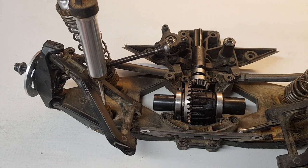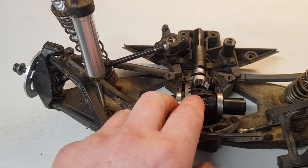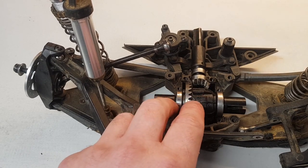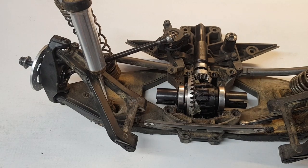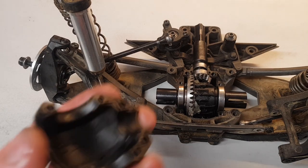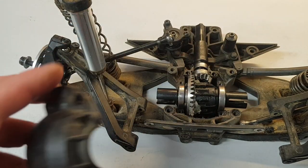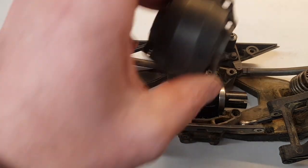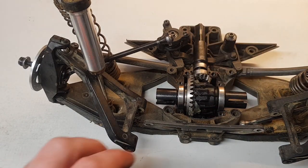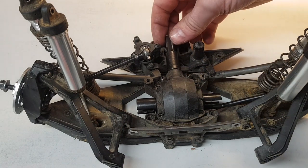Now you need to decide how much grease to put in. You don't need to pack it full — when it spins around it all flings off anyway. Just put a good amount on the gears. I'm using a good quality high-temperature multi-purpose lithium grease; there are all sorts on the market but use what works well for you. If you're worried about dirt getting in, you can run a small amount of grease around the edge to get a good seal. It's more of a problem on the rear than the front, and we strip ours down regularly anyway. Cap back on, then pop those four screws back on.